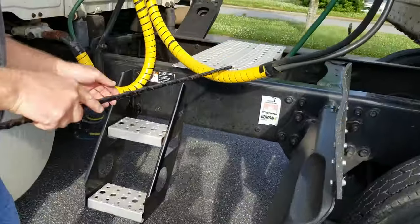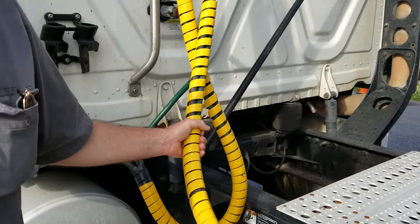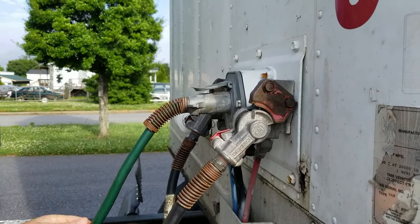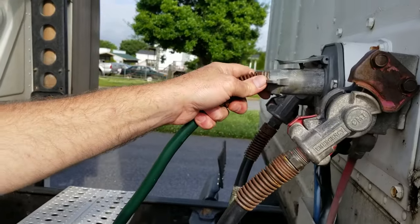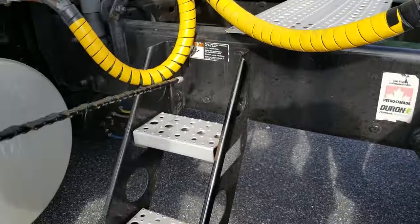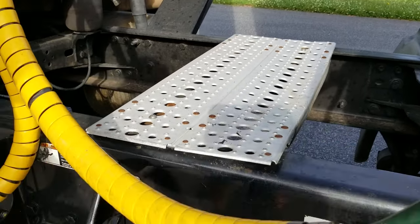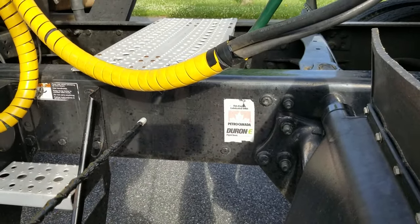I'll move back. I'm going to check my air lines, make sure they're not dragging against the frame, no cuts, frayed or dry rot on my air lines, and they are securely attached to the trailer with good glad hands. I will check my electrical line, make sure there's no broken or frayed wires, and it is securely attached to the trailer with a good latch. I'll check my steps and catwalk to make sure there's no obstructions and it will support my weight. I will check the truck frame to make sure there's no cracks, holes, illegal welds, or damage on the frame.